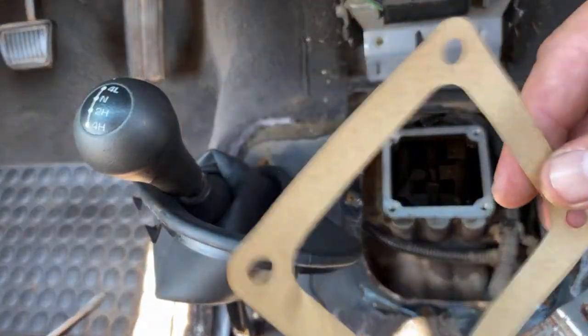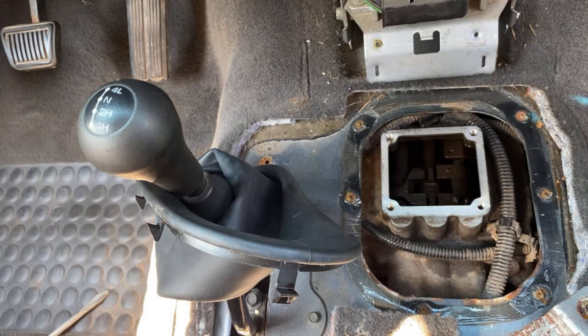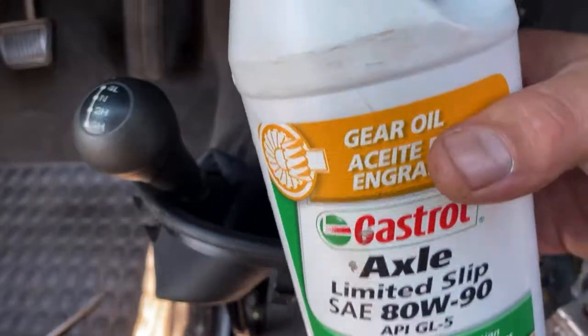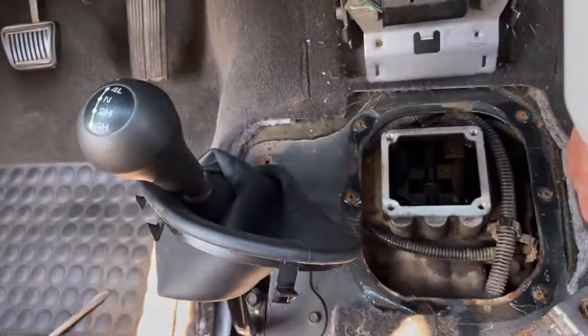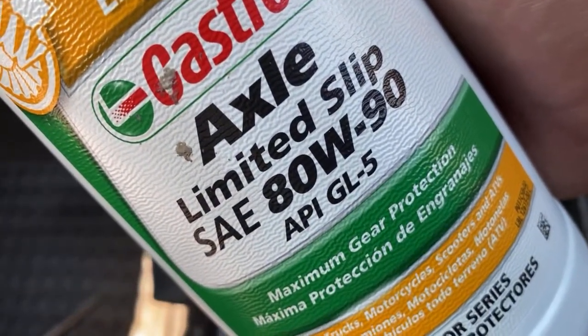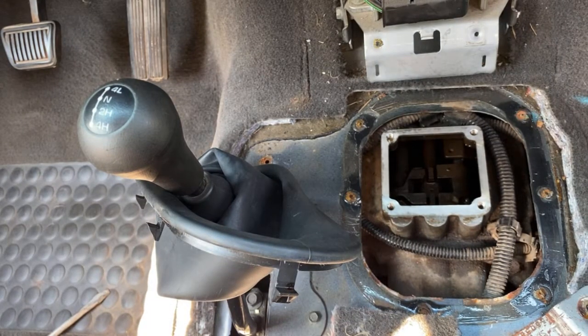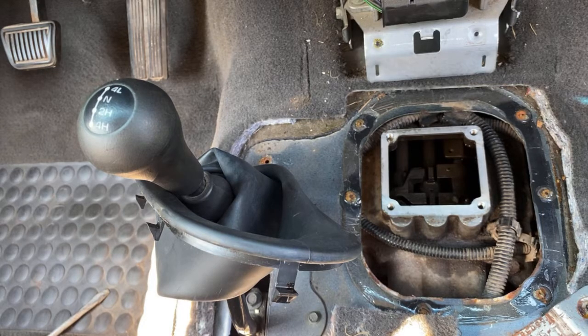Here's the paper gasket. I've got a little bit of — well, it's limited slip fluid, 80-90. It says API GL5, which this transmission takes GL4. If I remember correctly, I shouldn't mess nothing too much up. Should I? I don't know. I think I'll cut this tip real quick, give me a sec.